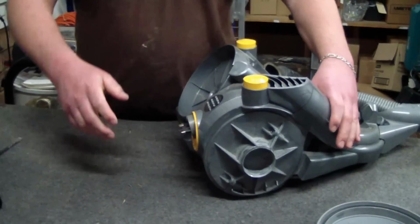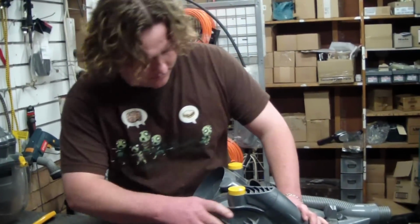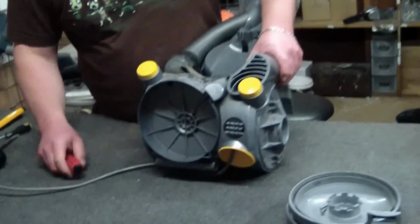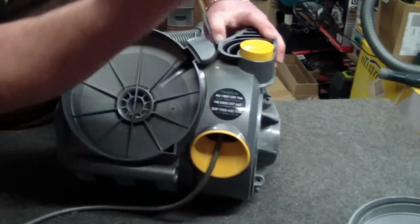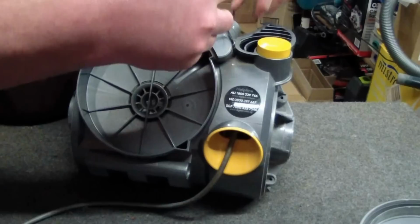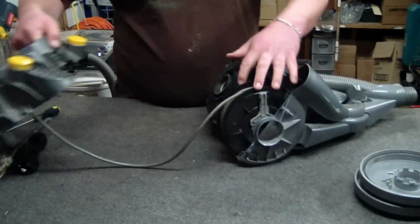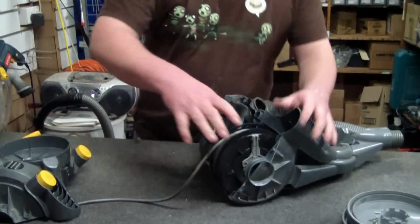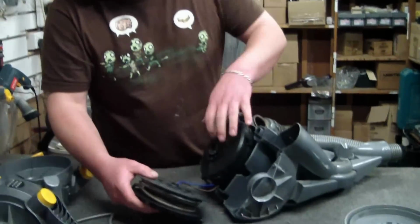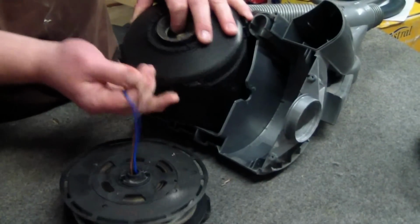Okay, now to make this that little bit easier, first step, just pull out a couple of foot of cord, grab hold of the, oh sorry, there's one more screw, look at that. Okay, so screw up in here, okay, so back to it. So we just pull off the whole door. Move that out of the way, and what that does just allows you to get a bit of clear movement here. Now in this case I'm going to be refitting this, but let's say you weren't. You just loosen up your cords here.